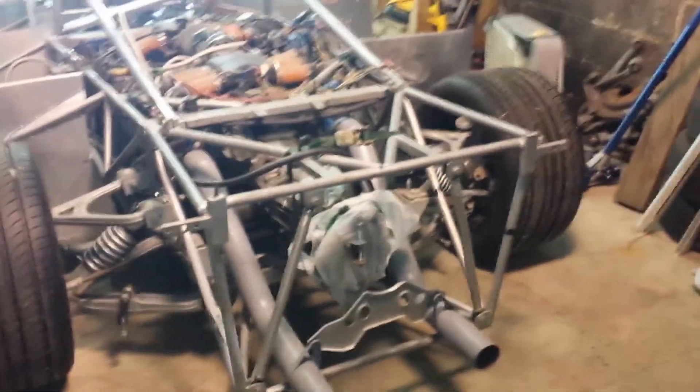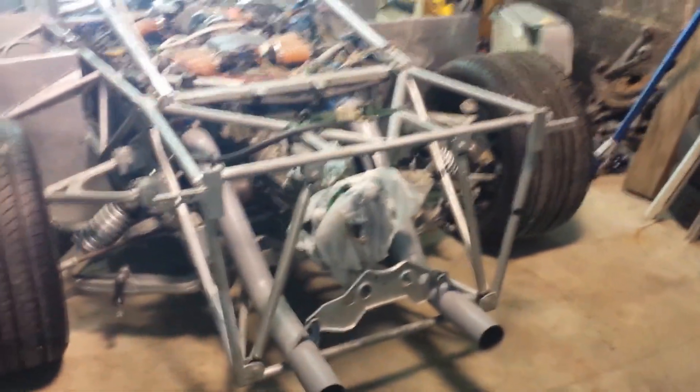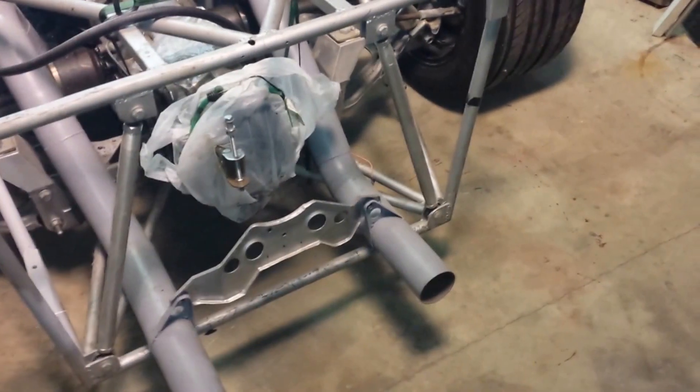This is six liters, 12 cylinders, all aluminum, dual overhead cam, four valves per cylinder — rather than the two with the Porsche. I've got the firing order staggered so one cylinder in each engine fires at the same time. They'll be staggered so the sound comes out of the exhaust staggered rather than simultaneously, which will make it sound like a 12-cylinder rather than a six-cylinder engine.